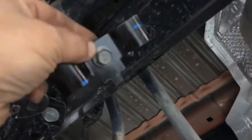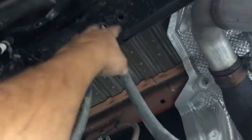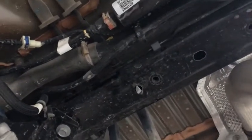And anyway, this is the cross member. And for reference, this bracket was back inside of there. That's a 13 millimeter. So you have to, once you disconnect it, reroute it under these fuel lines. And here's the cross member. That way, all this section is not interfering, so you'll gain some distance for your parking brake cable. But basically, that's what that's about.